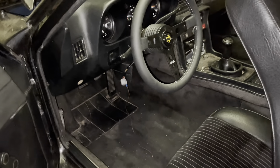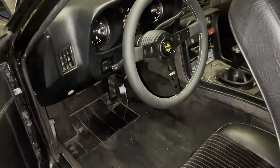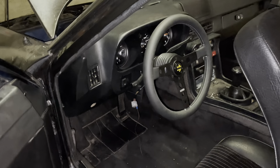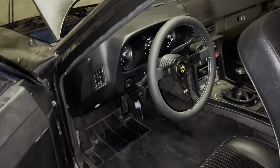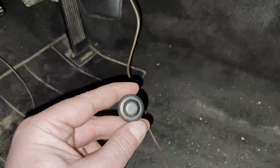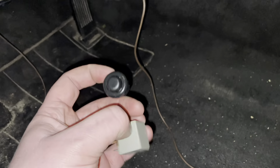We've got the lights working, but we are struggling with the horn — that's not really working. What I've managed to get working so far is that the horn button activates the relay, but the relay is not connected to the horn whatsoever. I think both horns are dead because even with 12 volt directly on them they're not making any noise. One of the previous owners had a bodged switch wired in, but it no longer works. I think the relay is gone and the switch is not great, so maybe I'll MacGyver a new switch to get through the road worthiness and then fix it properly after.